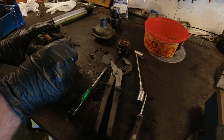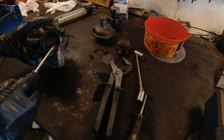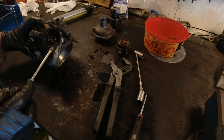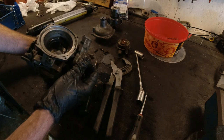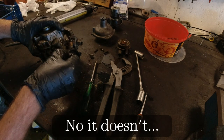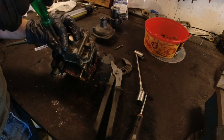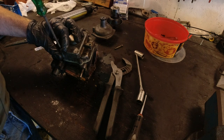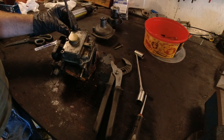Here is the mechanism inside and it seems to be moving a bit, which is really good. I'm guessing that opens the throttle butterflies and probably lowers the jet. Let's continue exploring. This seems to be a pretty big float chamber compared to SU HS carbs, but I think it's just bigger floats - probably not more fuel, just a bigger chamber. How this looks inside will be a good indication of what the fuel tanks are like.